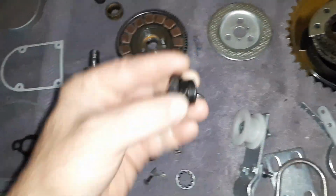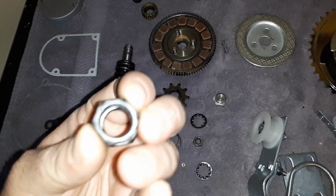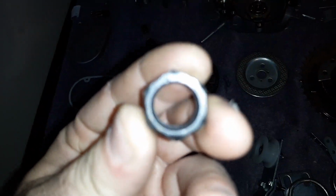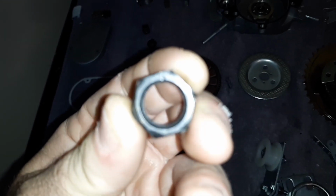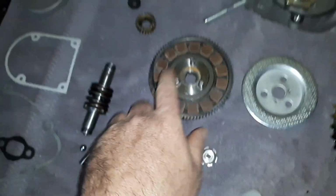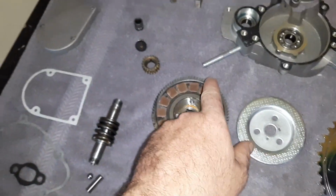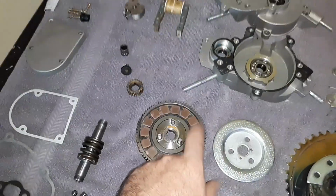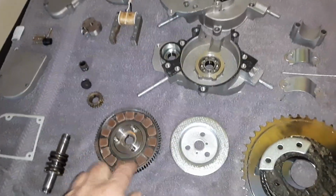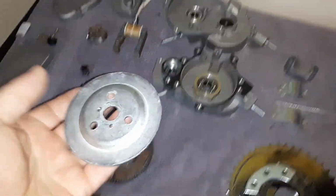Alright, we got through these there. They did have all hardened nuts. These are usually stamped in 3 spots. They call it staking the nut. If it'll focus, which I doubt it will, you'll see it right there. They had this thing fully staked. Big plus there. Okay, the clutch, they actually included the clay rubberized ones that have the grit in them. That way they grip more, they last pretty long. They're really hard.